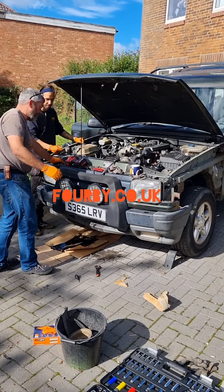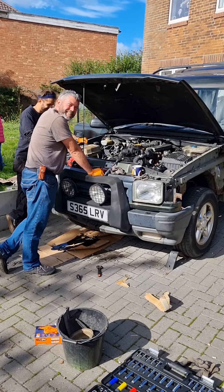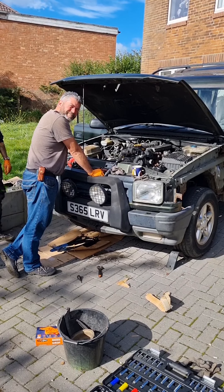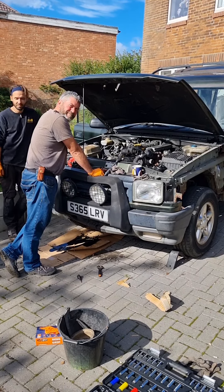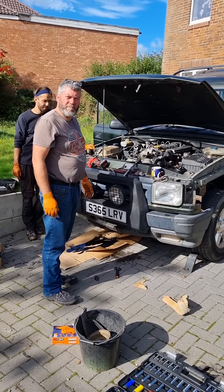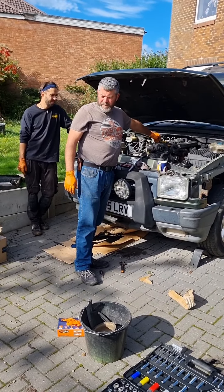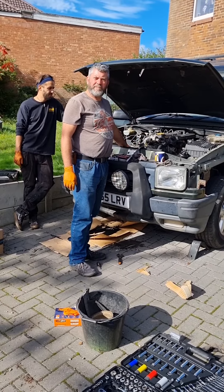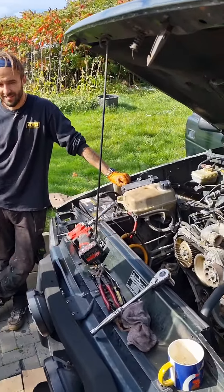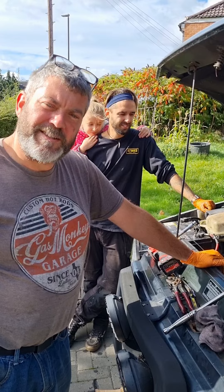Hi Neil, how's it going? Can you give us a quick synopsis of what's going on here? We were having some interference in the valve, so we've done the tappet clearance and reset the timing. As a result of that, it fired first time. But it doesn't sound quite right — it's not revving properly — so that's our next level of investigation.